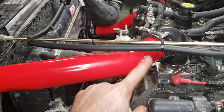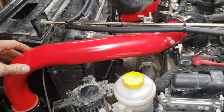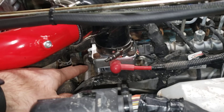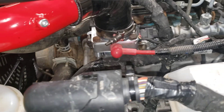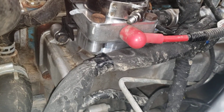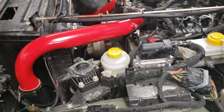Leaving the intercooler, this pipe right here — you don't need to use this if you don't want to, but it's for a sensor if you want to install one. It moves around a good bit, so I'm probably going to have to secure it with zip ties, because all good things are held together with zip ties and duct tape and baling wire. The intake connection kit right here — you reuse the heater coil inside, everything else is new from Wade. I was very surprised at how bad the OEM intake connection was and how much blow-by it was allowing.